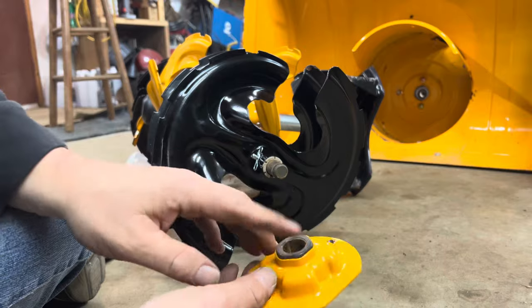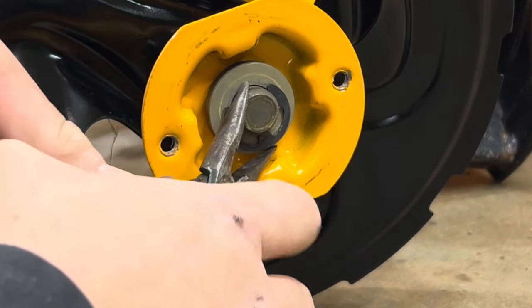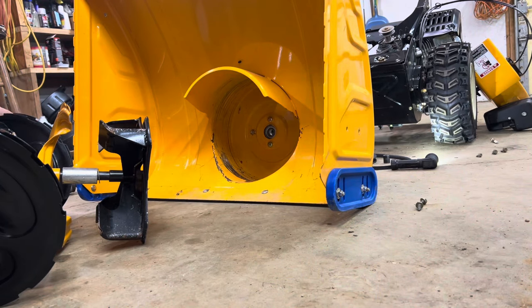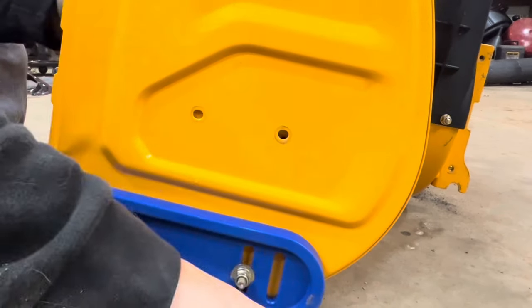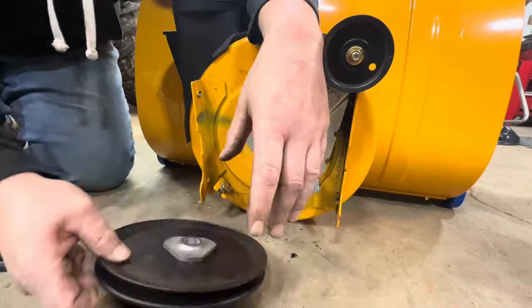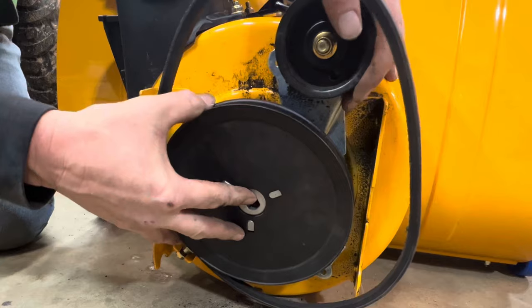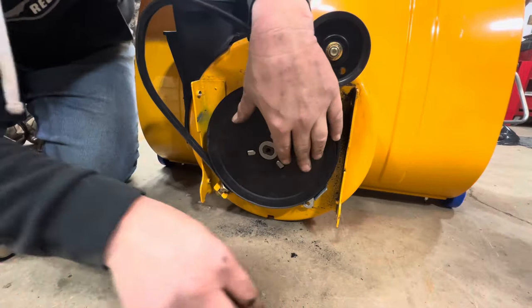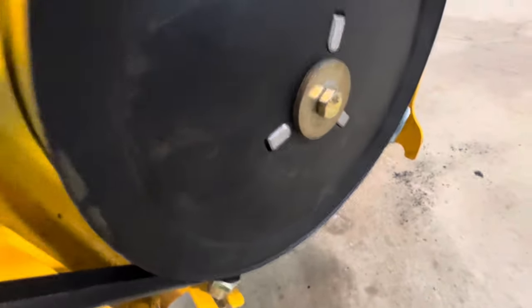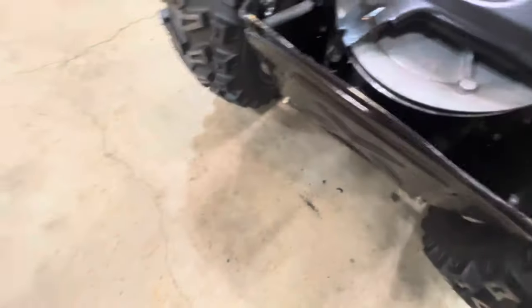Put your bearing holder back in where your bushing is, put your washer back on, put your clip back on. Take your auger and put it back in the hole — make sure it's all the way through. Pull back up your bearing holders. At this point we can put our pulley back on and put the belt back on. Take your tensioner and move it out of the way, then mate the snow blower back up to the blower, remembering that those two little hooks go on the dowels, and it should just piece itself back together.